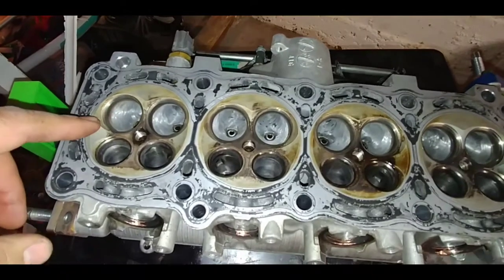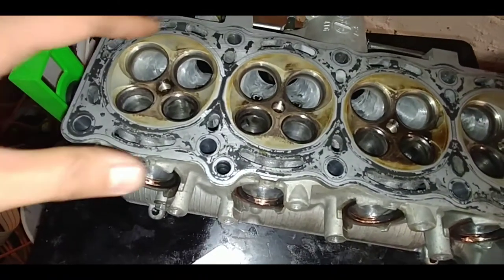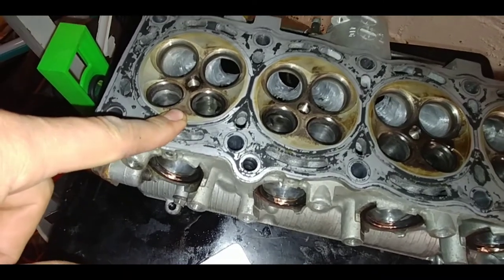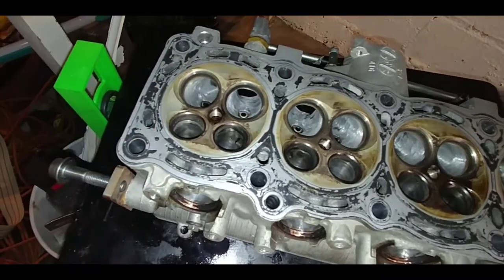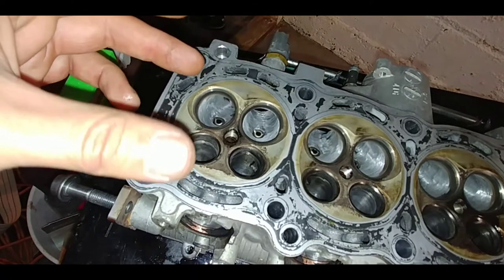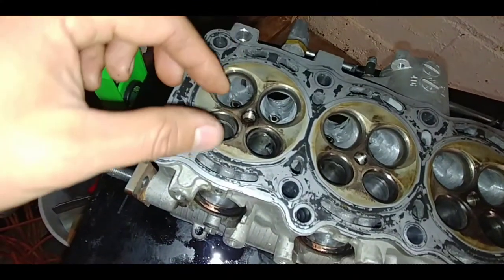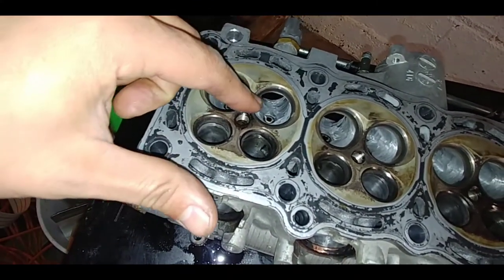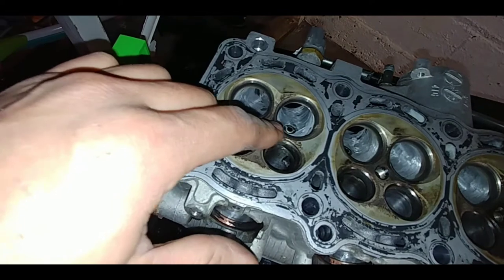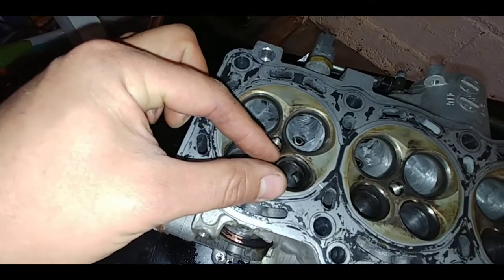The reason you want to get rid of all this carbon buildup is, one, it's flow — you're going to disrupt your flow a bit. But the main thing is it creates hot spots. A hot spot is basically when air comes into the chamber, into the piston cylinder wall, the spark plug ignites, and it focuses on igniting in one spot — usually your higher points on your piston or cylinder head where there's buildup. That's why it's called a hot spot.